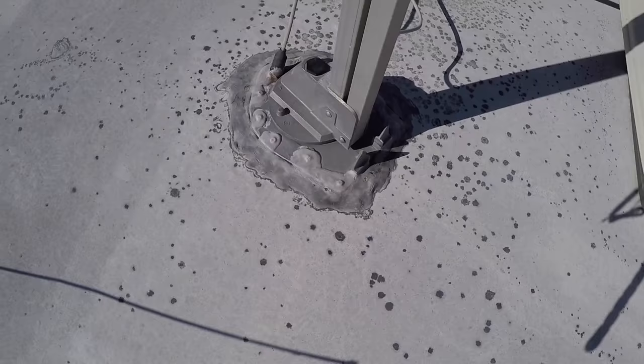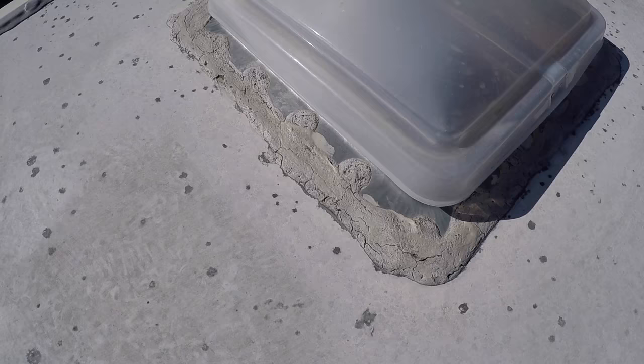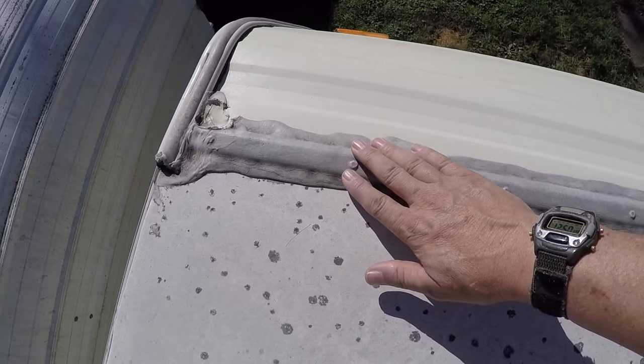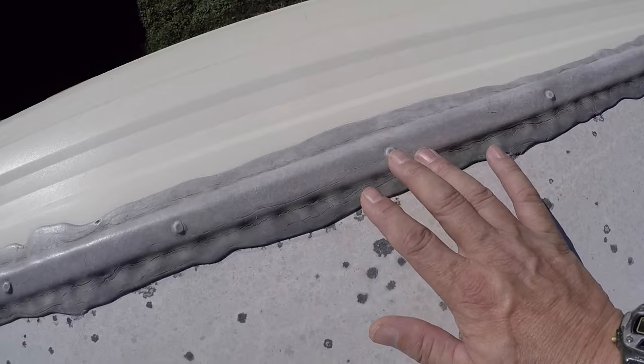These spots I think are just stains and mildew in the rubber roofing. Here's around the antenna, a little AM-FM antenna — it's pretty bad, it needs to be done. And this vent up here. On most campers, there's a seam at the front and the back. This is the front seam between the metal siding and the rubber roof, and this is more of that lap sealant, but it's really old and cracked.